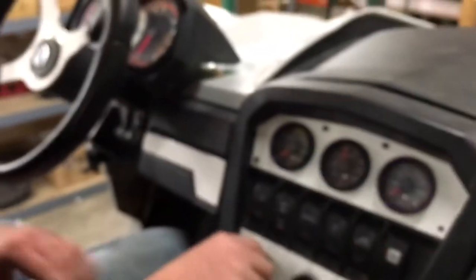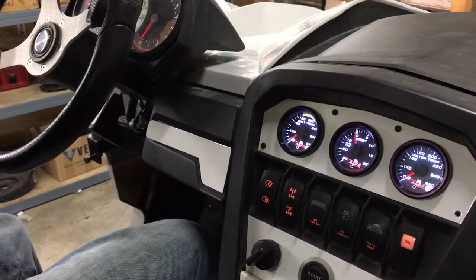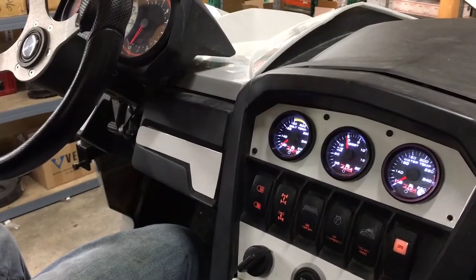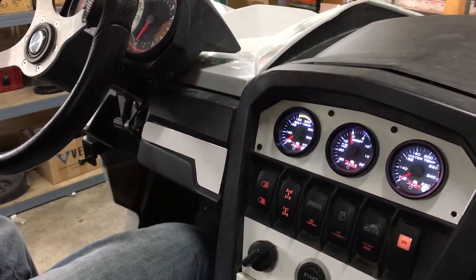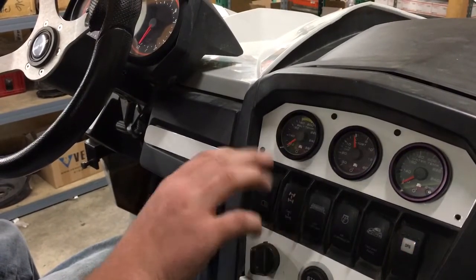We're going to turn our key off, then turn it on — this gets our gauge into its initial programming function. If for any reason we don't get a good program on the first try, turn the key off and start over. If you don't make a good connection and try it again, it's unfortunately not going to be able to program without being reset. Always start by turning it off, turning it back on, and then you're ready to program.